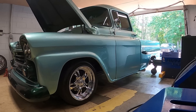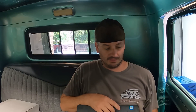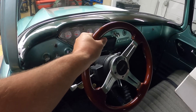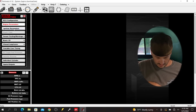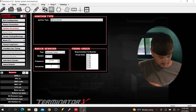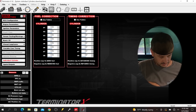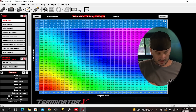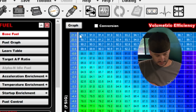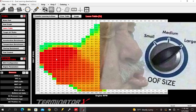I'm guessing we're probably going to have to essentially start all over again, which is fine, but hopefully the problems are within the way it's set up and not mechanical. So let's take a look. I'm going to verify the injector part number. You can see the problem already - this is a naturally aspirated deal, there is no turbo, there is no supercharger, and we're scaled to 22 pounds of boost. Hopefully if we just correct our scaling it'll be smooth sailing, but it's pretty rough.